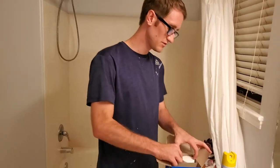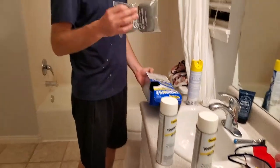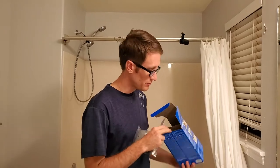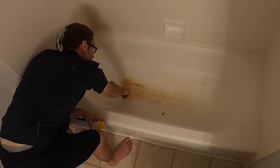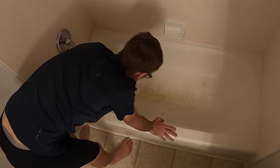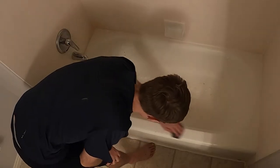First and foremost, it comes with two cans, gloves, and very fine steel wool. Then it comes with a cleansing packet — mine's not in the box, which is kind of annoying. I'm going to use this Walmart brand foaming bathtub cleanser as a good substitute. The water pools right here — there's a natural lift, and that's why this started to rust, because over the years the water sat and pooled there and rusted through. So we're going to spray some of this stuff and get all the rust up as best we can.